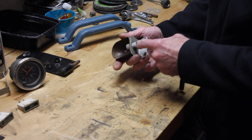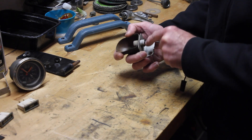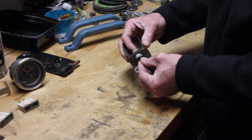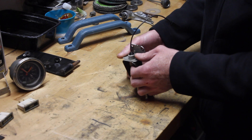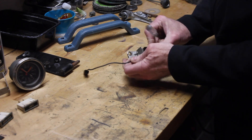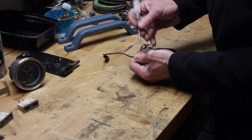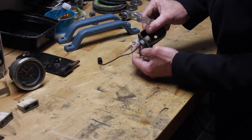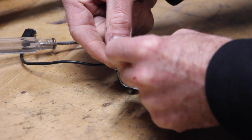To take this thing apart, there is a very small metal ring — a retaining clip ring — right underneath the main part. You can see there's a spring on the inside that helps when you push the light bulb in, it kind of pushes this thing down. So we just need to remove that little clip ring. Get yourself some kind of a small pick. You can kind of pull this thing out a little bit. I wouldn't put too much stress on this wire if you can avoid it. Just get underneath that little wire clip there and kind of pop it out. And that's what I mean by a very tiny wire clip.